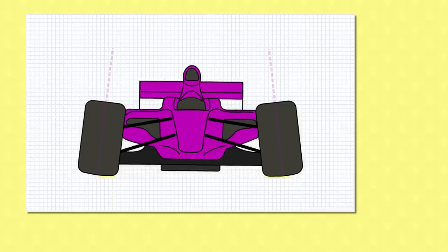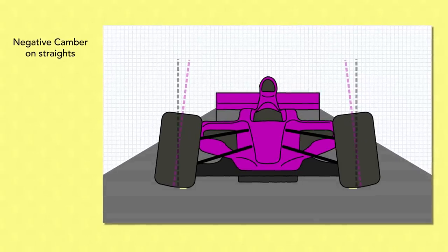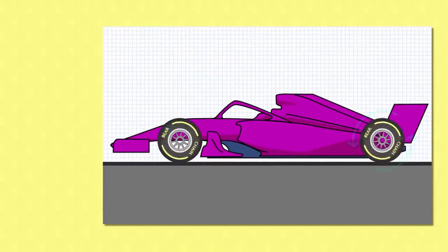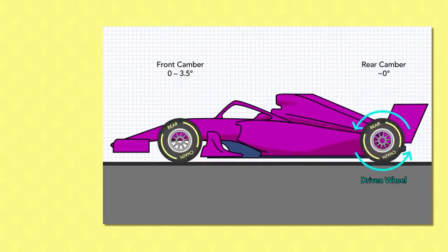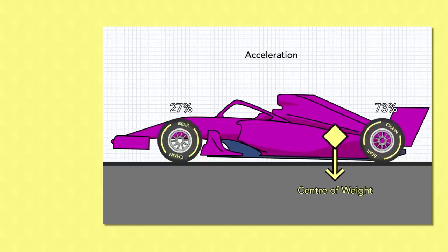But negative camber isn't perfect — it does come with some drawbacks, and as with all set-up decisions, tyre camber is about balancing its effects across different situations. When the car is powering down a straight, the negatively cambered tyres are resting not flat but more on their inside edges. This not only adds more load to the inside shoulders — bad for durability and increasing the risk of punctures — but also adds to wear and heat. It will also reduce straight-line traction, affecting acceleration. This isn't a huge deal as the burden of acceleration is mostly on the rear tyres, which tend to have pretty neutral camber, keeping their rubber flat to the track for the big moments on the straights.